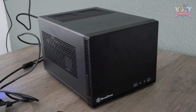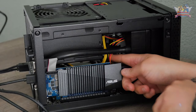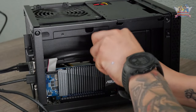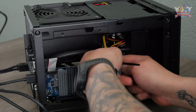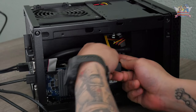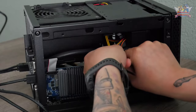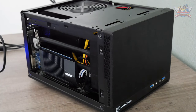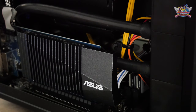On first boot there was an immediate noise — I had negative flashbacks to the shitty fan on another PC I'd dealt with before. But I figured it out fast: one of the cables inside the case was scraping the 120mm fan just a little bit, causing that annoying noise. I tie-wrapped it safely out of the way, and now it's dead silent. The only fans spinning are the 120mm fan and the power brick fan.